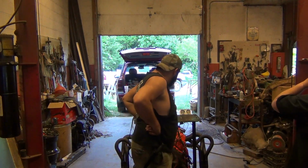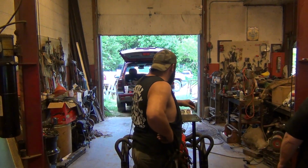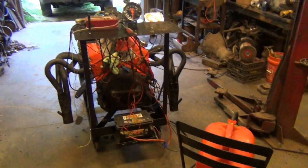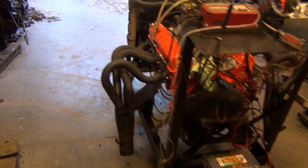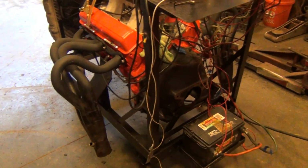Oil pressure's rock solid though. Oh yeah, oil pressure's almost 80. Up at 170 degrees, that ain't bad at all. Yep. All right, so I revved it right there, and on the first revs the rockers come back loose again. So them stock jam nuts on them rockers just ain't gonna cut it, and this thing wants way more fuel than what that little pump's able to give.